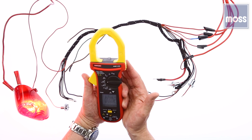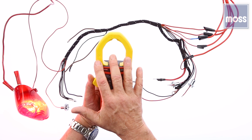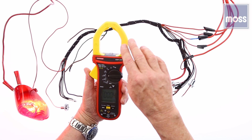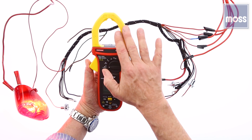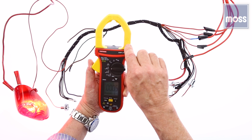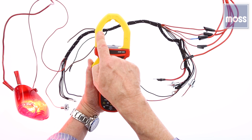Maybe you're saying that would be a terrific tool to borrow or even to own. If that's the case, there's one key feature you want to be aware of. These meters were originally designed to read AC — alternating current — that's what goes into your house. But we're working on our car. The car has DC. We need a meter that can read DC, and that's a bit of a challenge because most of them read AC just fine. DC is a step ahead. We need to find a meter that will also read DC — it has to be in the specifications. The windfall is, while a meter that reads AC may not read DC, a meter that reads DC will almost always read AC with no problems at all.